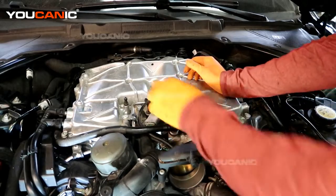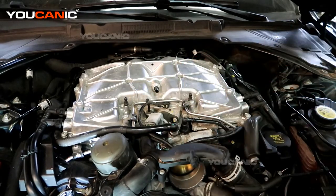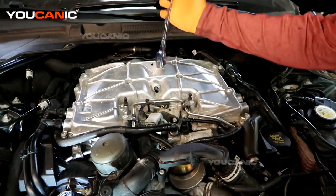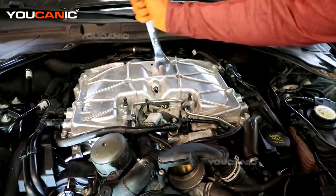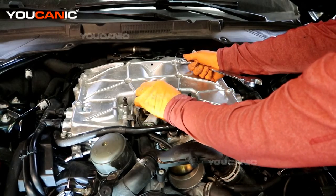We need to move this little connection back — it's got a safety lock — then squeeze and pull. We need a 22 millimeter wrench. It shouldn't be in there crazy tight; you just need to get it to break free, and then it'll come out.